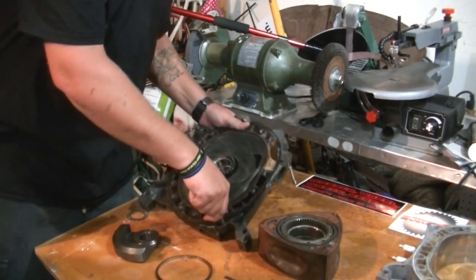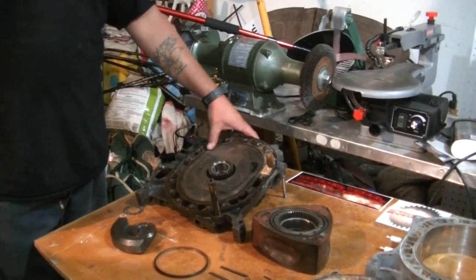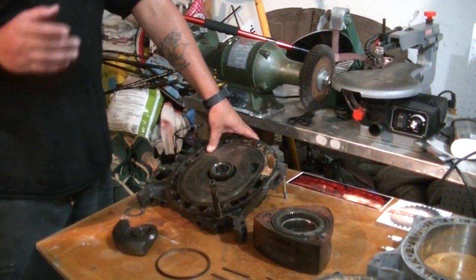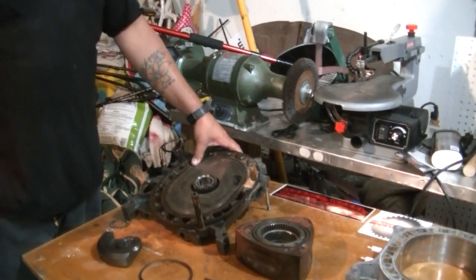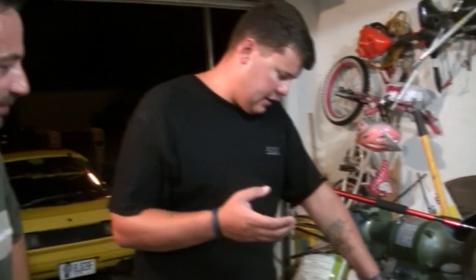So if I can interrupt for just a second here, this doesn't have any conventional four-stroke engine type valves. This is much more like a piston-ported two-stroke in terms of valving. Correct? Very much so. What we in the rotary world call it is our four-stroke two-stroke. Simply because you put oil in the engine, and the designers have incorporated a manner to put oil to the fuel. We do not mix it, by factory specs, like you would a two-stroke. But I'll get more into the pre-mixing into gas and fuel.